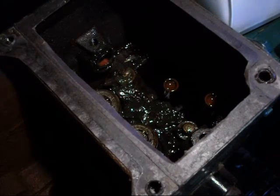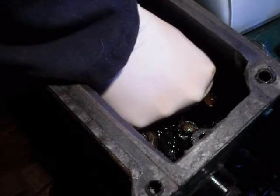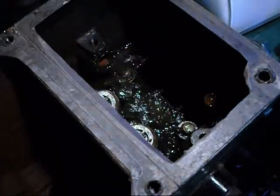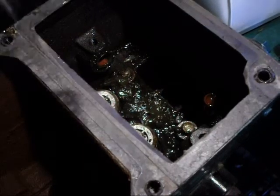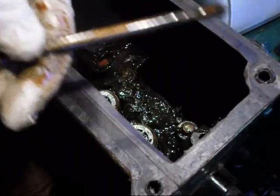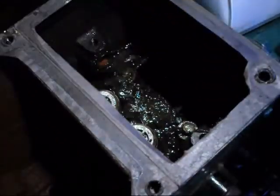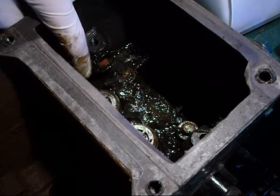It's a jolly good idea to reassemble all that on the workbench so you're not going to lose any bits. The next thing is to just lift out the pushrods. Now on the end there — that's the cup which the bottom of the rocker sits in, so you don't want to lose that. It sits in a cup on the rocker, right down working on the cam in the crankcase. We must remember that that is the left hand valve. I think it's fair to say all this stuff needs a jolly good clean — we've even got a dead bug in there.